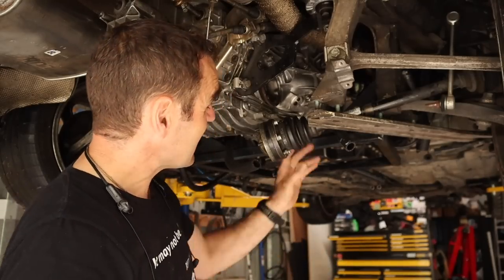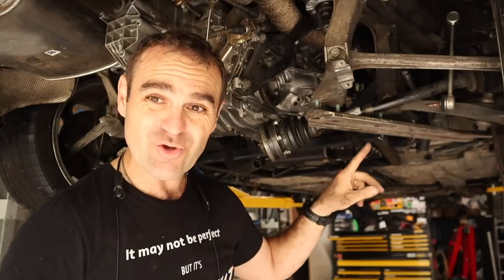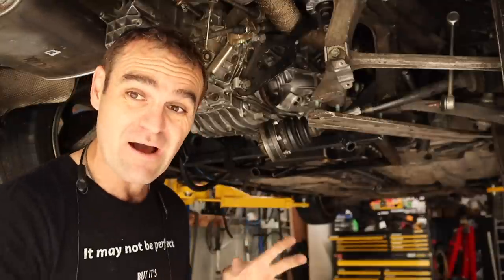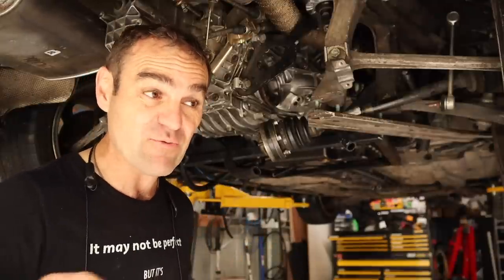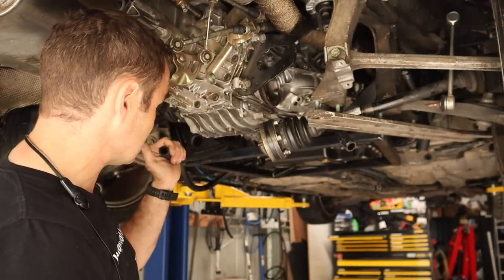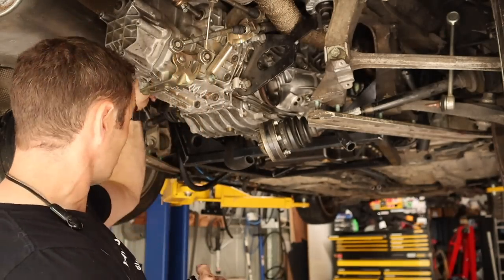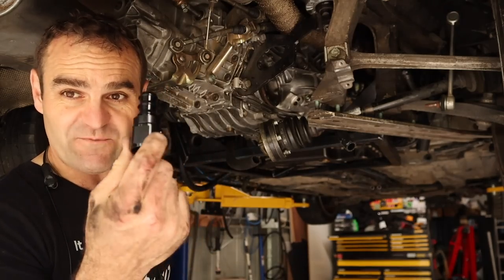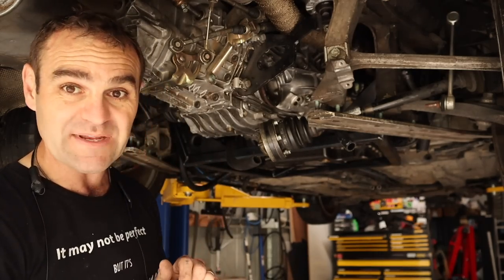Redoing things — I've fed through this new overflow hose. This is the original heater hose, and this is where the overflow is going to go now, which is basically where the original Boxster had it. I'm going to put a T into this — I've cut it, there's another pipe up in there, so let's put the T in. A few Raceworks push-lock fittings and we should be all plumbed in.